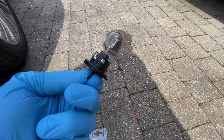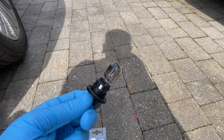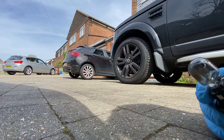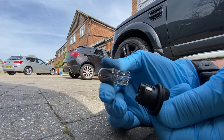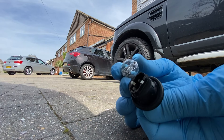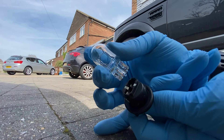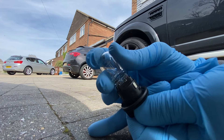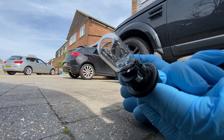The first thing I'm going to do is remove the bulb out of the old holder. You can see the electrical connections there, which is why there's no plug on it or anything like that. To remove it, all you need to do is basically just pull it. It just sits in here - give it a pull and away it comes. You can see how it fits in there, just slides in simply. With the new bulb, using gloves - don't touch it with your bare fingers - just grab it and insert it back into the fitting. Give it a push down, there we go, nice little click - we know it's in place.